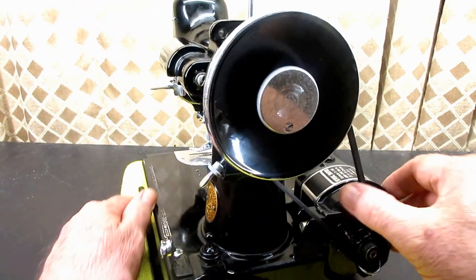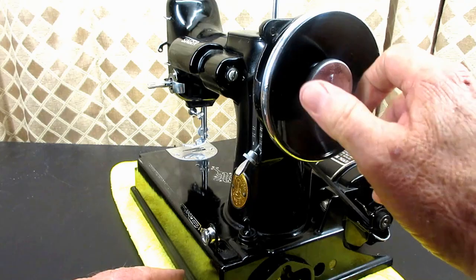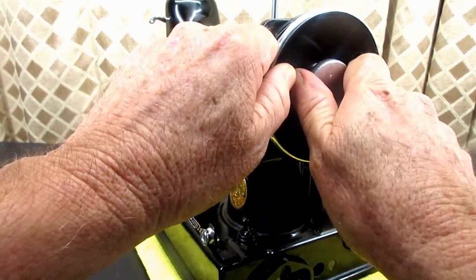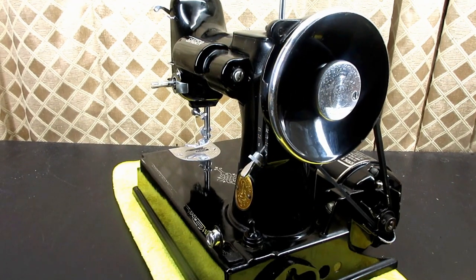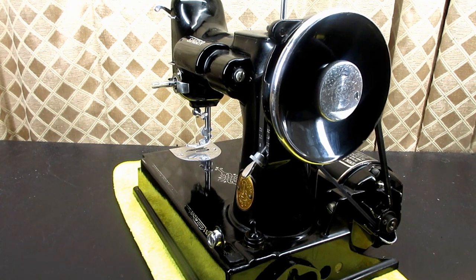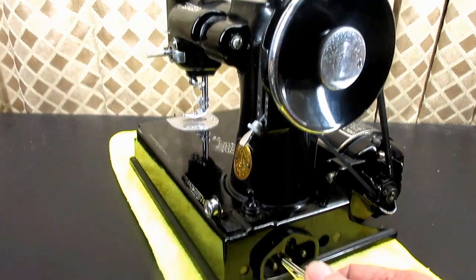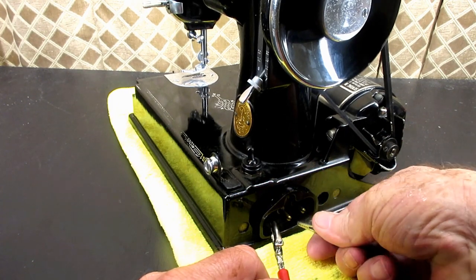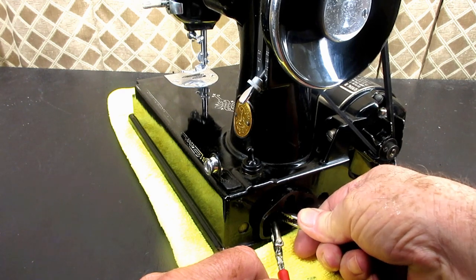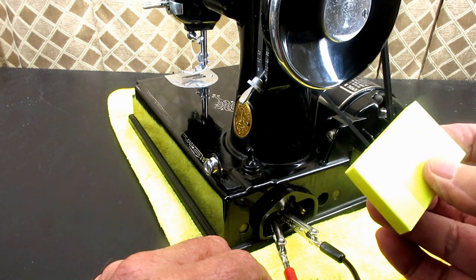Okay, so that's how easy that goes on, because it stretches a little bit. I'm going to put this in the bobbin winding mode, and we're going to hook some power up to it here and run it. They talked about this in their video, and I did an earlier video about removing and replacing the belt on this machine when I took the motor off. I'm just going to hook some power up here to pin two and three, which is where the motor terminates.